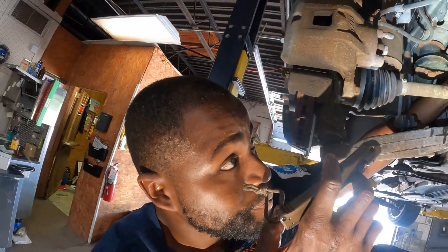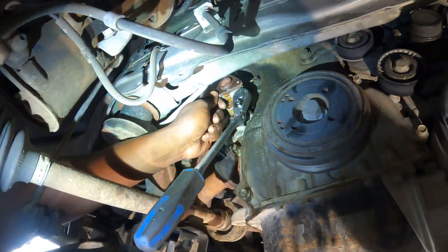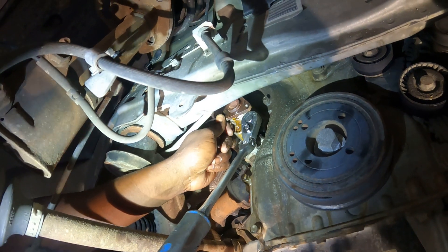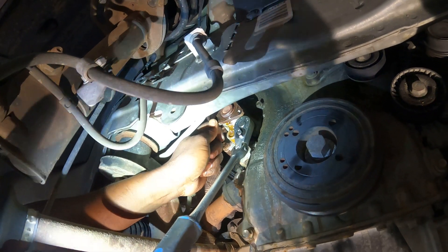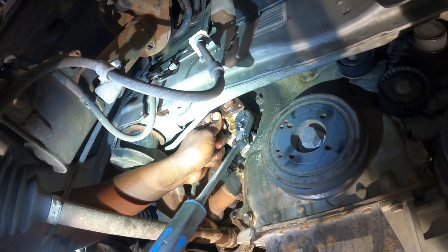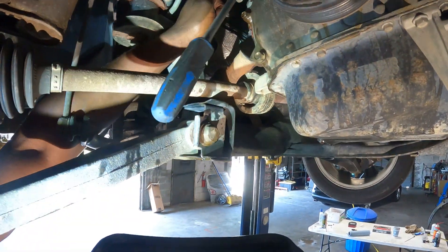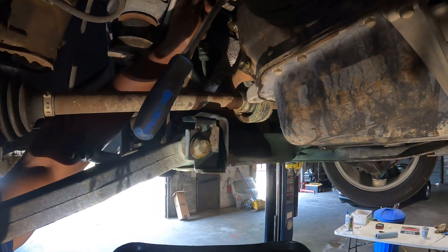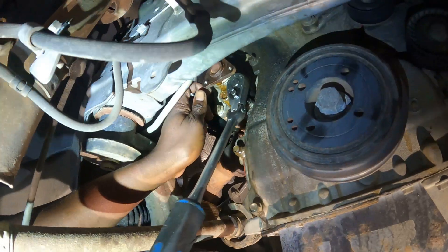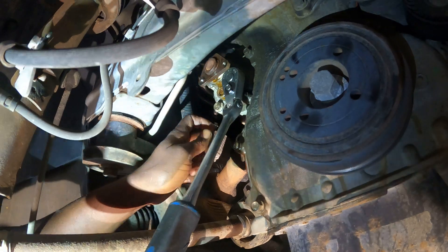Let me go over a few things real quick. You see this shaft right here? You will notice losing coolant out of this shaft — you see how it's coming out? That seal is breached and you start dripping coolant. So you will notice coolant right around the front passenger tire in your driveway — you can get some spotting. If you're parking on the lawn somewhere, you probably wouldn't see anything at all, but you'll notice coolant being lost out of your vehicle, and adding it would be a telltale sign that something is wrong.